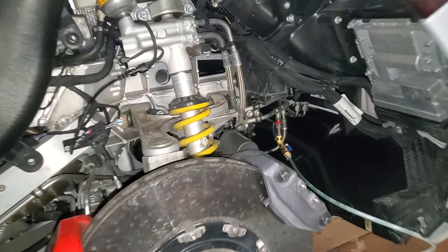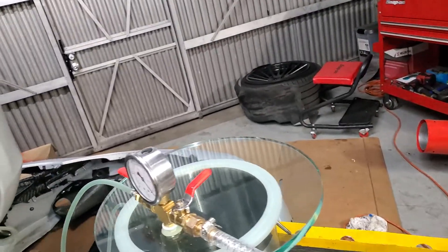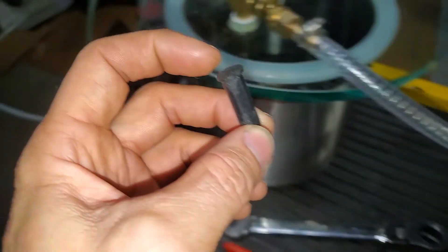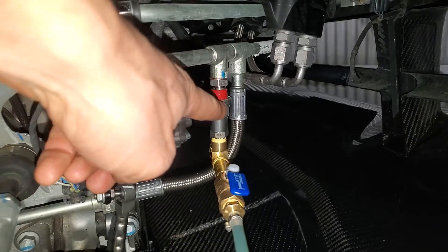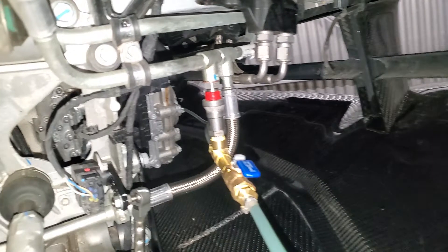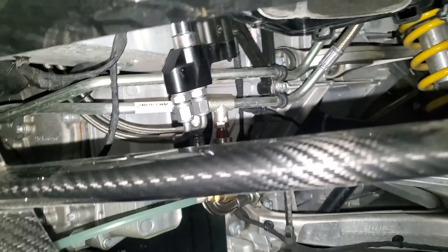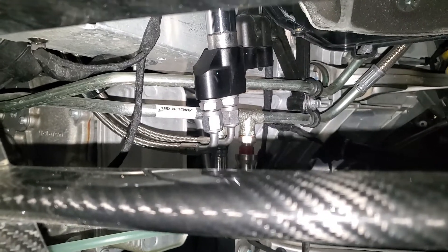Go ahead and connect our device — the two QC4s — with the valves from the QC4s to your resin trap and fill system closed. This just clicks on to the back. To get access to the port, you'll have these little black covers that protect them right here. To get those covers off, you just lift up on the red here while pulling down on this, and then you'll have the nipple exposed. Go up to these two access ports — you can access them from the rear wheel wells down in the back. Plug in the QC4 connectors to that, and at that point you'll be tied into the system.